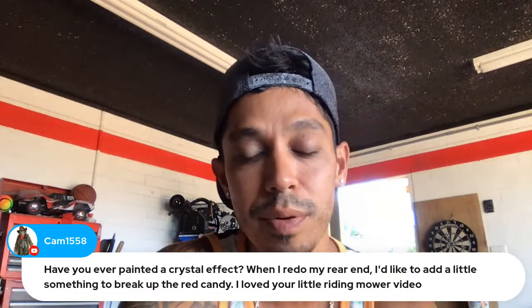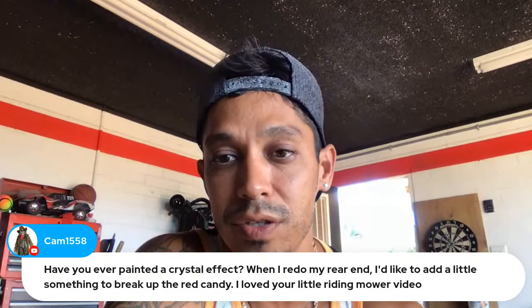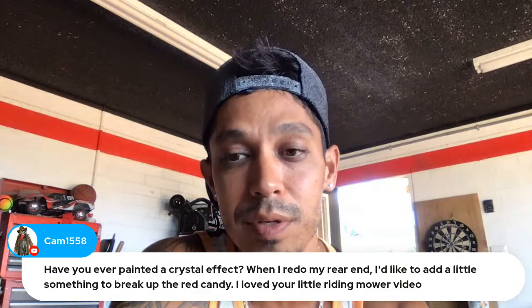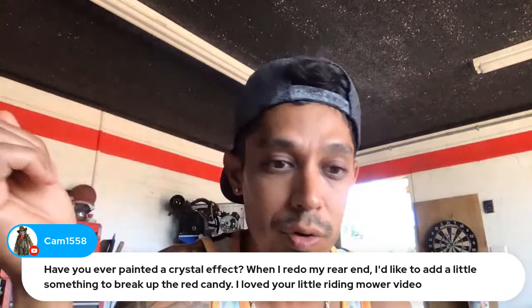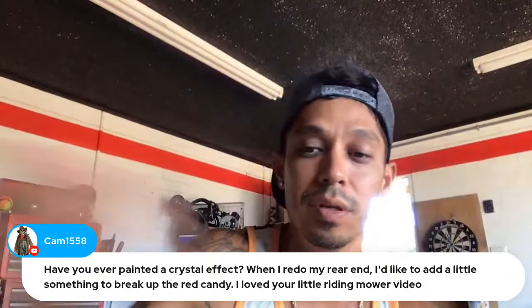Yeah, absolutely. You could put it in clear, or you can put it in a mid coat, which is a clear base coat. You could use a carrier, like DBC 500 by PPG. It's like a clear base coat. You mix it up, add your flake, pearl, or crystal effect, whatever, and then you spray that on, and then you put clear coat on top of that.